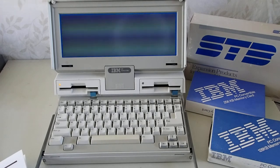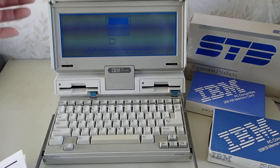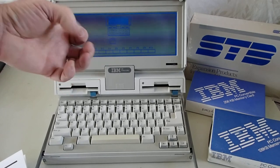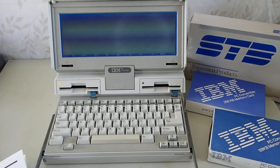That is also the same as on the last BIOS of the PS/2 model 30. There's further animation showing to insert the start diskette in the drive and press the F1 key. It's more likely that the drive is broken — in a later video, I'll show replacing those drives with functional units. When I put in the diskette, it actually shows it coming back out of the drive and shows it breaking into pieces in the animation — it's quite elaborate. I'll simply press the F1 key, it tries to access the floppy drive again, and then it drops us into ROM BASIC without being able to start up from any of the diskette drives.